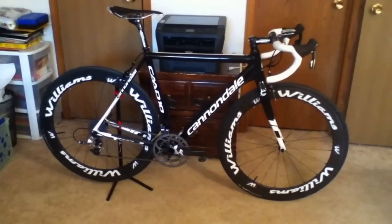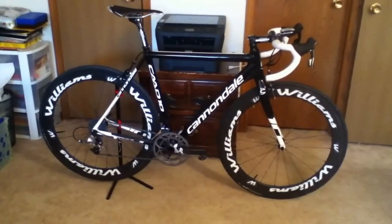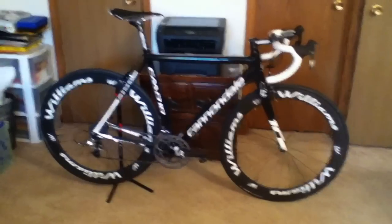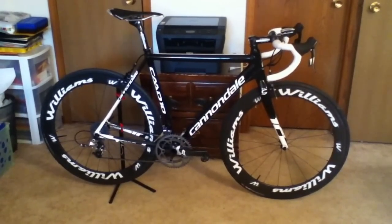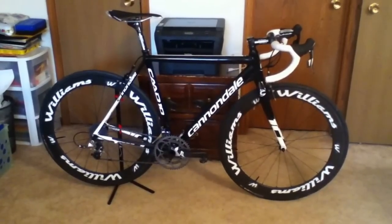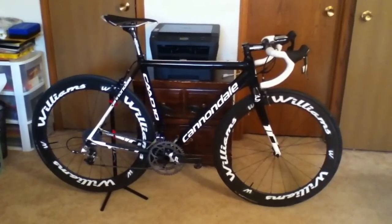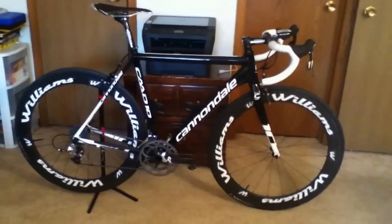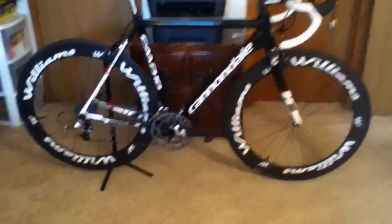Hey YouTube, so today I thought I would step away from my school books for a little bit and record a short video. I want to discuss a question that I've had recently and that I've seen on a few bike forums: whether or not the new SRAM 22 YAW front derailers will work on the older SRAM 10-speed groupos. On my bike currently I have a SRAM Force mixed with SRAM Rival 10-speed groupo, and I recently replaced my SRAM Rival 10-speed front derailer with a brand new SRAM Force 22 YAW front derailer.